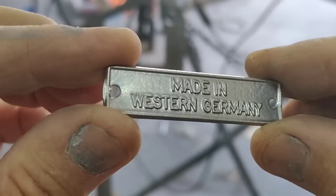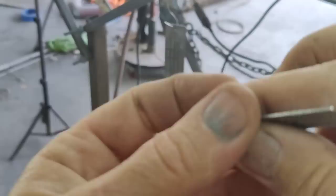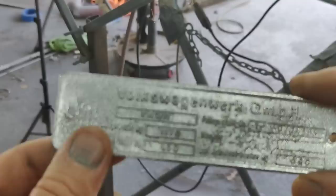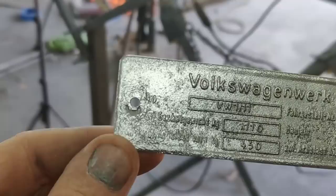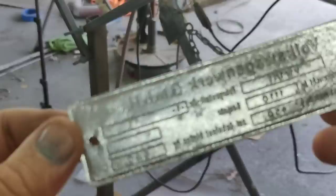Just so that it's like good protection for this thing. I mean, look how rusty it is. It was pitted this side, and then this side wasn't that bad. And this side, I wanted to be able to read the VIN still, so I didn't put it on too heavy to try and fill all that pitting, because you can puddle the powder coating on and it'll go on thicker and it'll kind of sheen up a little bit. So that's a trick of not putting it on too thick for this thing.